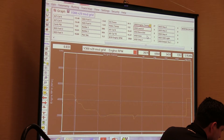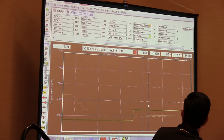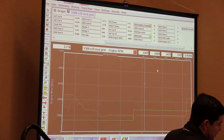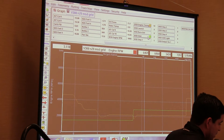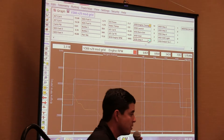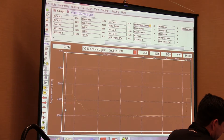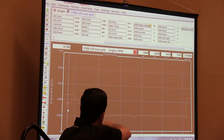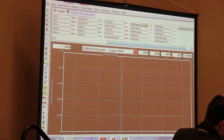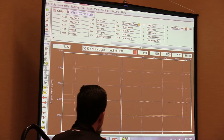Once he lets go of that, here's gear selection. Here's first gear — this must be a glide, and then it goes to second gear. So the MSD will count the gears for you. This is important if you have gear retards — you can see those activate. This will let you know that the MSD box is executing that correctly. Here's when the step retard activated on the MSD box — it goes from zero to one when active. Here's the rev limit. You can see the rev limit is active, holding the engine RPM down low. Once trans brake is active, as soon as he lets go, then it goes on the run rev limiter. In this case it is set to 8300. You always wondered if you tagged your rev limiter during the run — this is a quick, easy way to look at it.